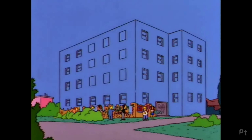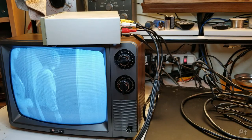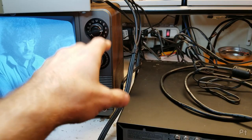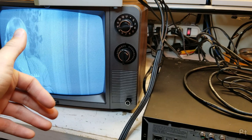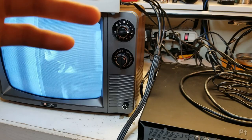These connection methods should get you to use any old vintage antique television — they all use the same RF connections going back to at least the 50s or 40s. You're going to get humming in the audio with high contrast scenes, and flagging of the picture from a VHS tape on older televisions that didn't have very stable horizontal sync. There are going to be other nuances, but generally these are the connection standards you want to be concerned with.